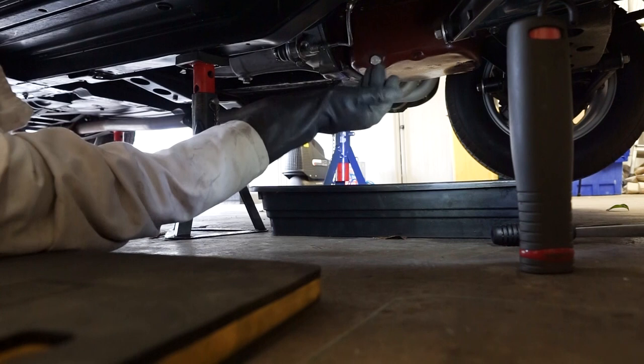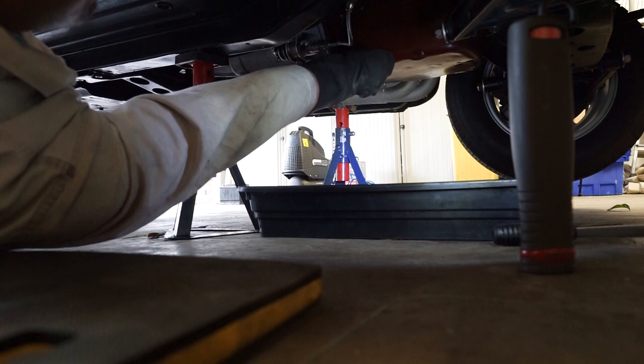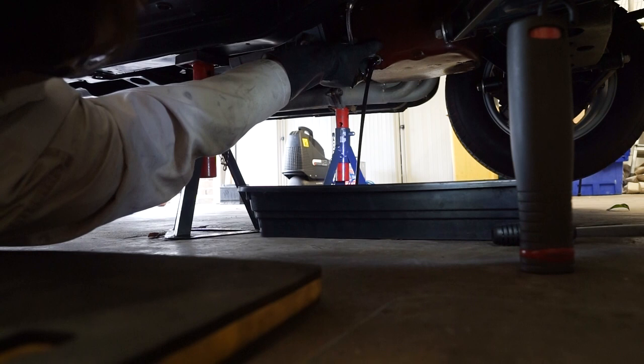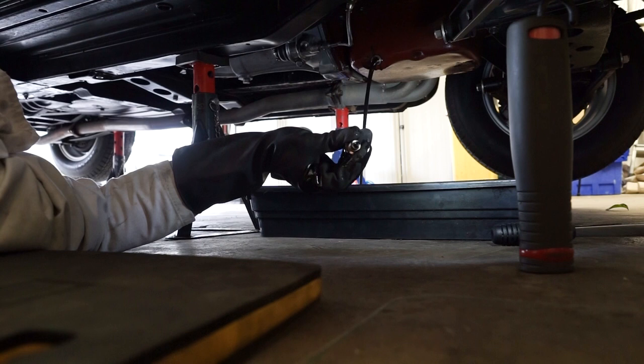I'm just getting the ratchet onto the drain plug to get it started. I've got a fairly thick rubber glove on, and what I do is as I take the drain plug out I keep a little bit of pressure on it just to stop the oil leaking out prematurely — and remember it is very hot so be very careful if you're doing this with warm oil. Now we can just leave that to drain. You'll see it's a magnetic drain plug, which is quite handy — we can have a look and see if there are any contaminants or bits of metal in the oil system.